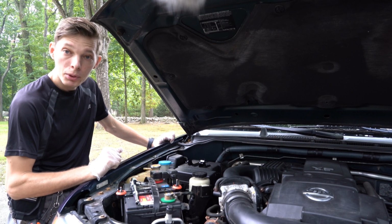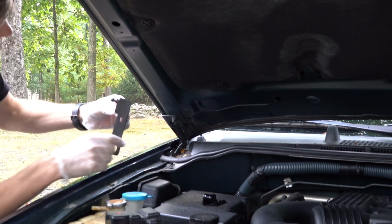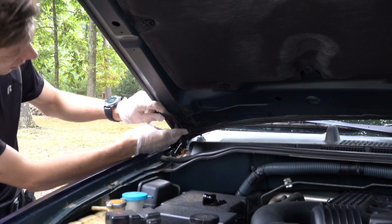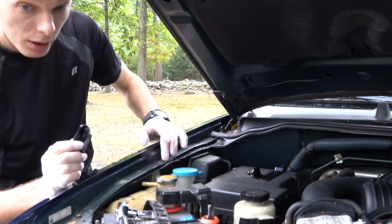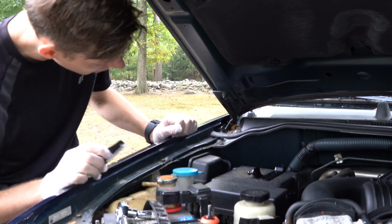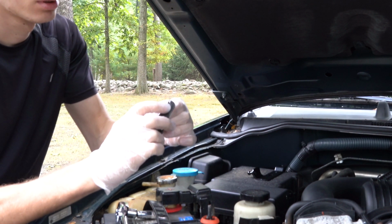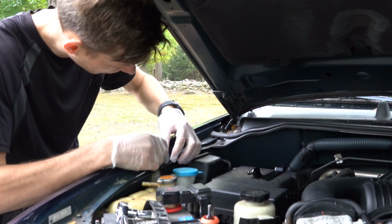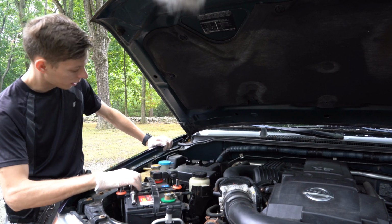So what we're gonna be doing is we're gonna remove these two bolts and we're gonna put this bracket to the right side over here, and then this little bracket, we're gonna remove this little bolt over here, which, like anything else, is all 10 millimeters in here, and we're just gonna put it over here. There is a little notch on this bracket that has to line up with the notch over here, and we just screw it in place, and then we put the gas struts in.